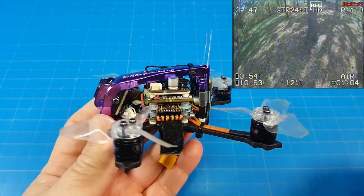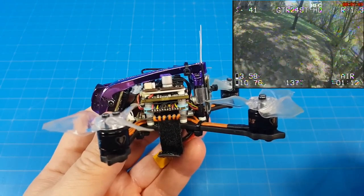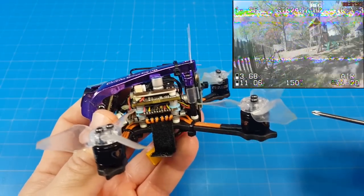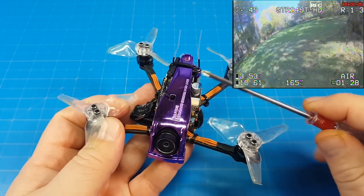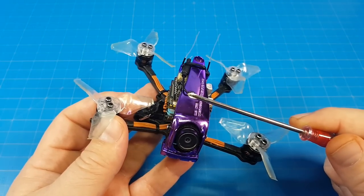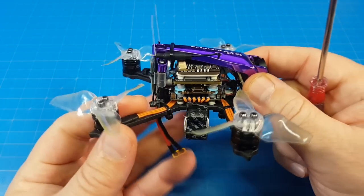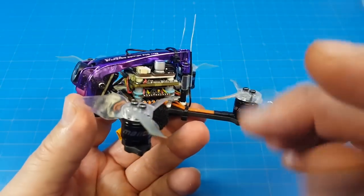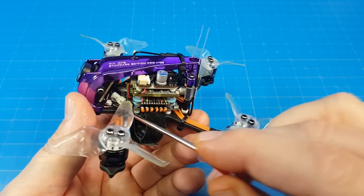I got a little bit of grass in there. Also, the flight footage yard won't look like that anymore — we got a snowstorm and leaves fell, so winter has arrived. The canopy and electroplating — I had a King Kong one that was plastic and it broke, but this electroplating appears to be a coating because it suffered no damage in my early crashes. For the buzzer they include, you'd put it right in here, plug it in via the connector off the ESC harness, and it's got a sticky pad so you can tuck it away off the bottom carbon plate.